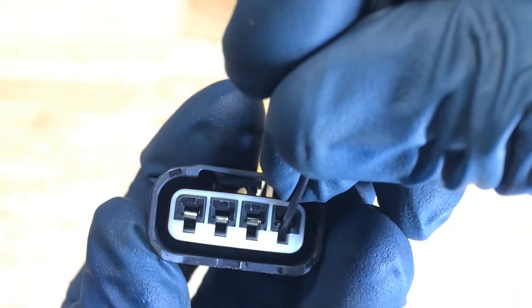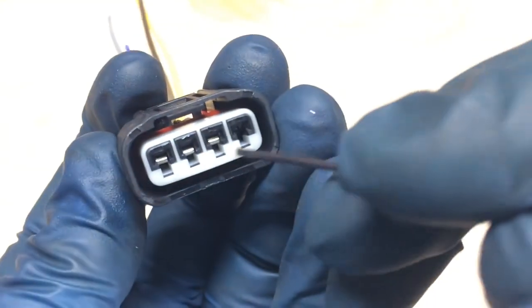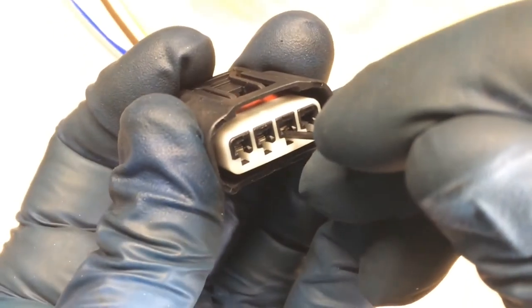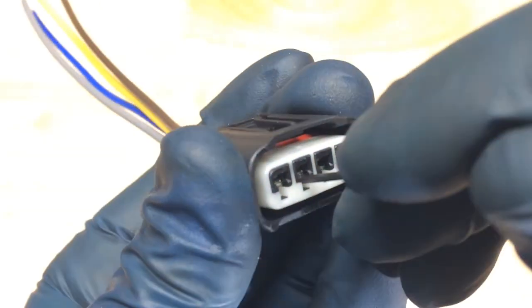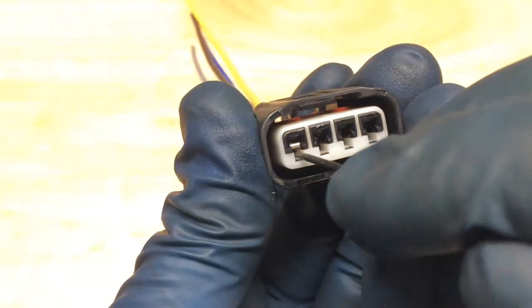Down. And see how as I'm pressing it down, I'm turning the screwdriver up, and that's pushing the wire out. If you get it right, it'll push the wire out. There it goes. Okay. So to show that again, going in there, that little tab, you'll see this in a little more detail later. If you get it right, you push the tab down and then push the screwdriver up at the same time. Same deal here. Get under, and they're easier to remove on the Amazon connectors than they are on the Toyota ones in the vehicle. So go in here, there it is.